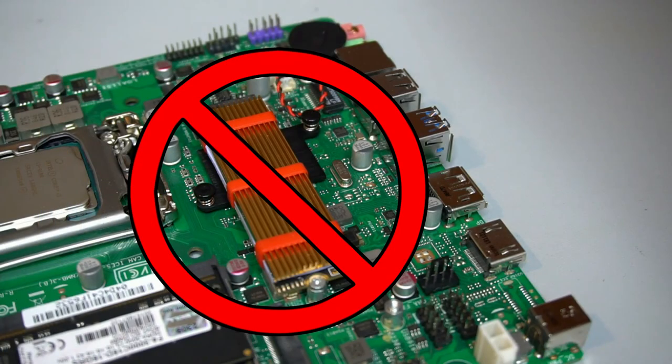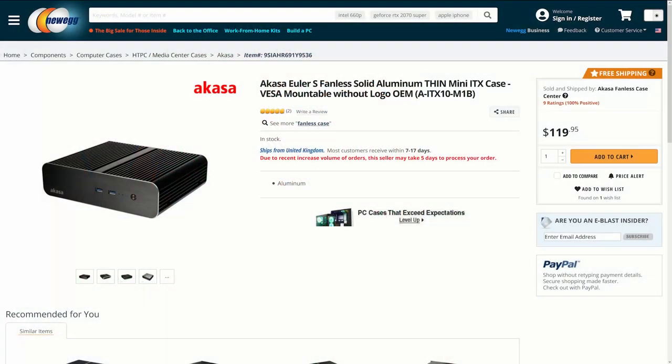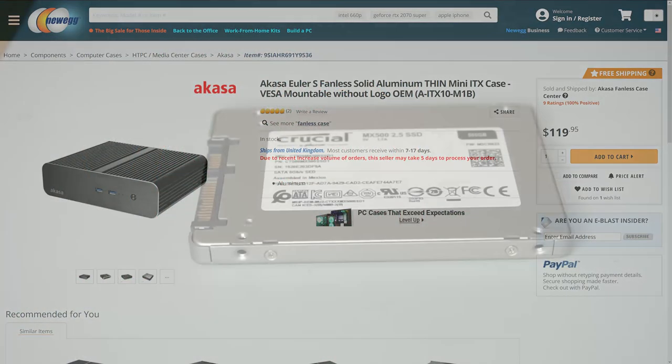I do not recommend using an M.2 SSD with this motherboard because it sits directly above the chipset and will get very hot, even with an M.2 heatsink installed. The full component list is in the description.